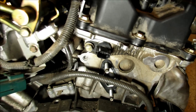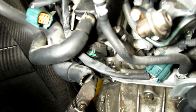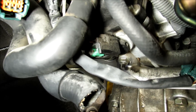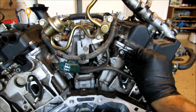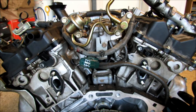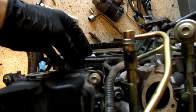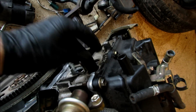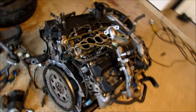There's the other one. I was hoping that gives a better visual so when you're trying to pull out these camshaft sensors yourself, it's always easier if you can picture exactly where they're at. Right there is the one on the driver's side, and the one on the passenger side is that green one right there. I hope that little video helped you guys on replacing your cam sensors. Obviously it's a lot easier with the motor out than it is with it in the car, because when you're in the car you kind of have to feel back behind here to find where they're at. So that'll do it for that video on your cam sensor replacement. Hope that helped you guys. See you next video.